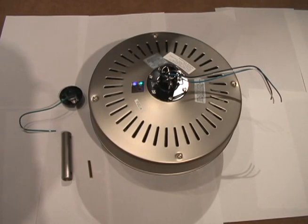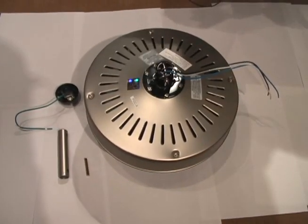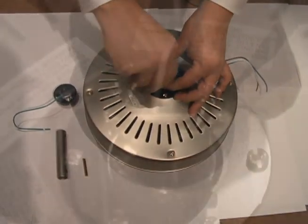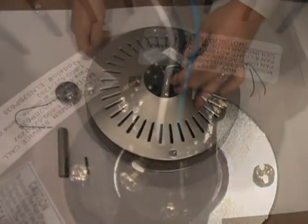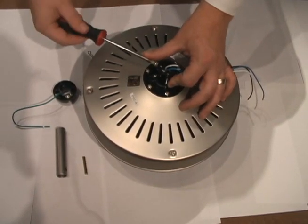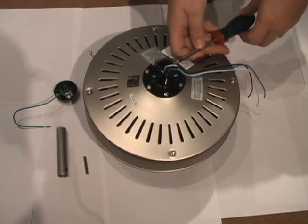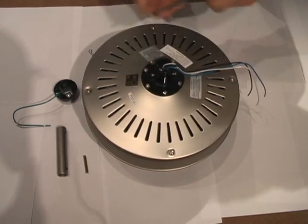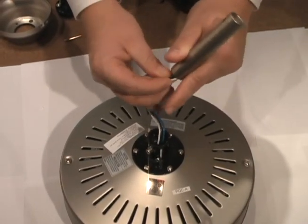The next process after doing your blade irons and blades is putting the down rod onto the fan. The fan comes with many safety features. One is the safety pin — it has to be removed from the fan first before putting the down rod in. Also, you have to back out the safety screws, which helps keep the fan balanced and the down rod firmly in place. Once you have backed those out, you put your down rod in and run your wires through the pipe.